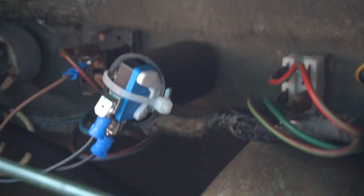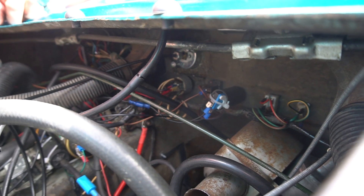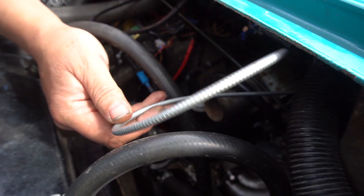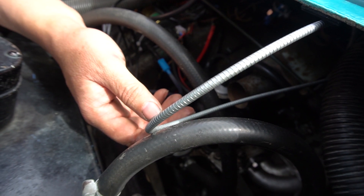So this is what it looks like — you can see the switch tie-wrapped in the original housing. And then I just mounted an electric pump here alongside the coil, again just mounted it with tie wraps — it's not going anywhere. A little bit more modern washer wipers. I've got to fix that wiper switch; I don't think it's a switch, I think it's a connection with the loom somewhere. But that definitely needs sorting. And this is the new choke cable, which I could really have cut down, but I've left it as it is — it's operating fine now.